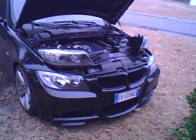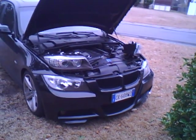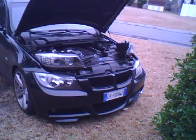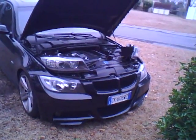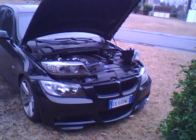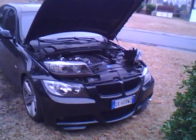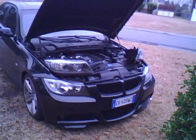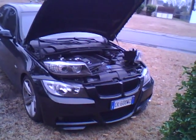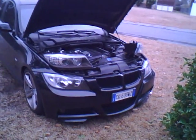So now we'll just run through the cycle of functions and tests, and then I'll send them out. On this one, the passenger headlight has the stock 4300K — yellowish — corona ring bulb, and the right has the JP Thunder bulb that will be coming with the set. I have it set up like this just so you can see the difference. Your high beam and the halo rings will both be around 6000K, the JP Thunder, which is a little bit more, but the halogen bulbs burn a little bit lower in temperature compared to what an HID temperature would look.